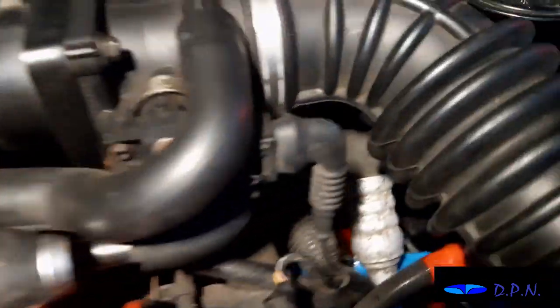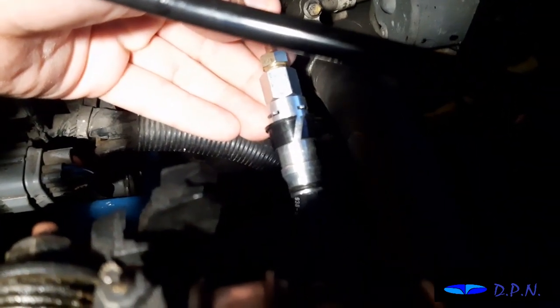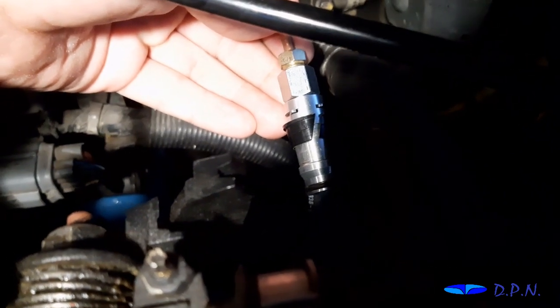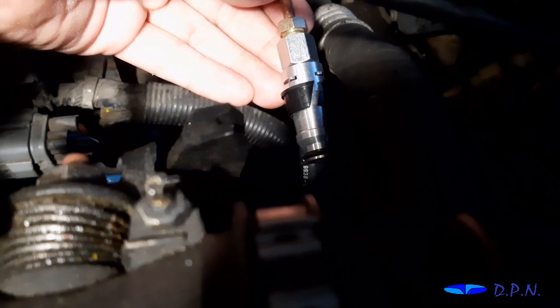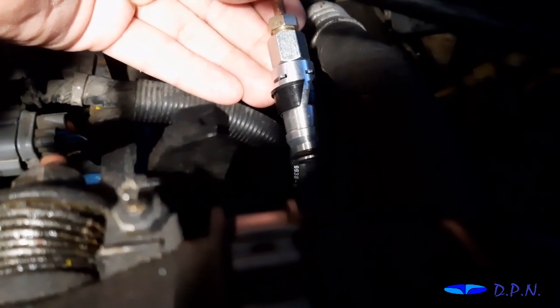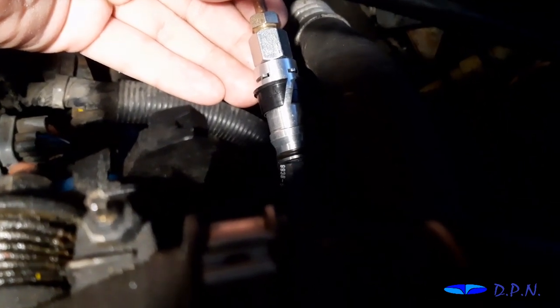And the way they suggest getting the air out of the system on this one is this valve here, the little centre pin, will be pushed in, and that should let the fluid out, and you pump, a bit like when you're bleeding the air out of brakes. You'll push that in and push the pedal down, and then before the pedal comes up you'll let that spring back out so you don't suck any air, and the process goes, you've got all the air out and as much fluid in as needed.